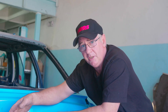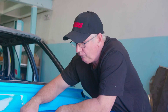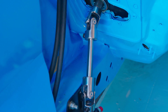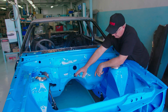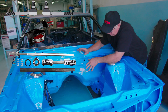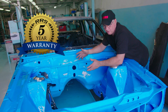You can use a standard power steer pump, our aftermarket pump, or our newly developed electric power steer pump. Because we provide this as a complete kit with a column conversion kit, some critical factors apply during installation — making sure the angles between the two universal joints are equal. The kit comes complete with inner tie rod ends, mounting brackets, and a full steering column conversion kit for whichever model vehicle it's applicable for. This is all part of the reason for our five-year warranty because it's a comprehensive kit.